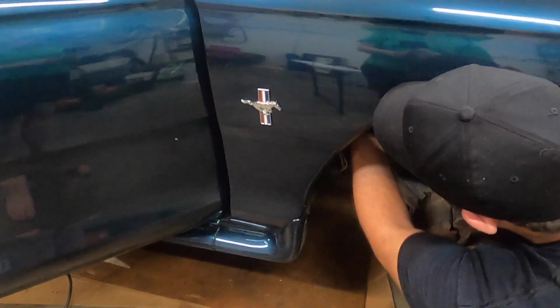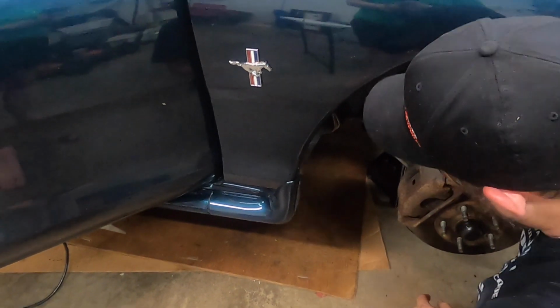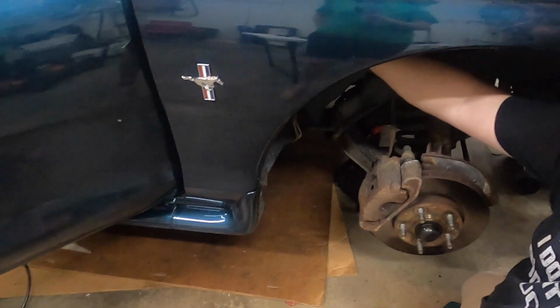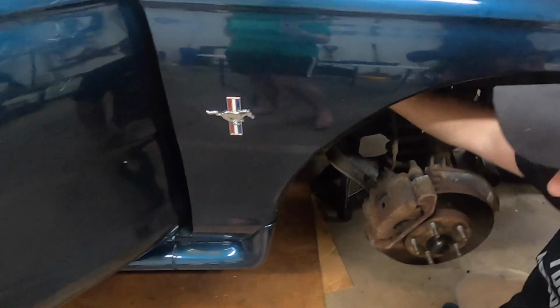And back to that ECU where we were showing. I know it's a little dark, lights in the car, but we're going to push it down and in through there. The easiest way to do it, I found, is take your fingers and push straight up, and then you'll just slide the connectors through, as I struggle to do it. There we go. Once you get the connector in, take your finger and just push it down to start feeding it down towards the ECU. Feed it in a little bit.